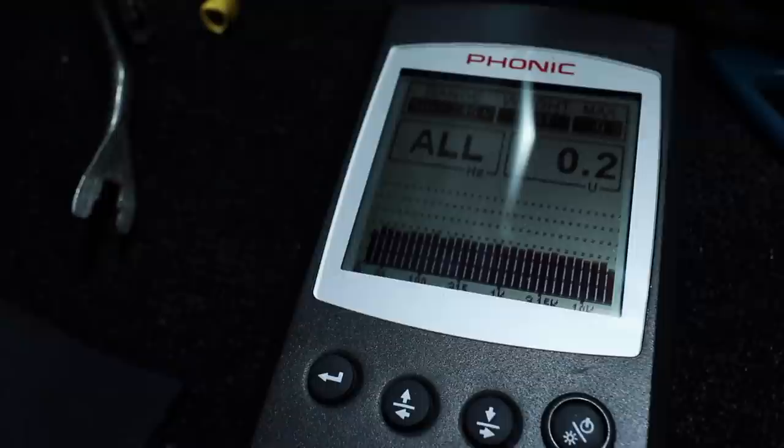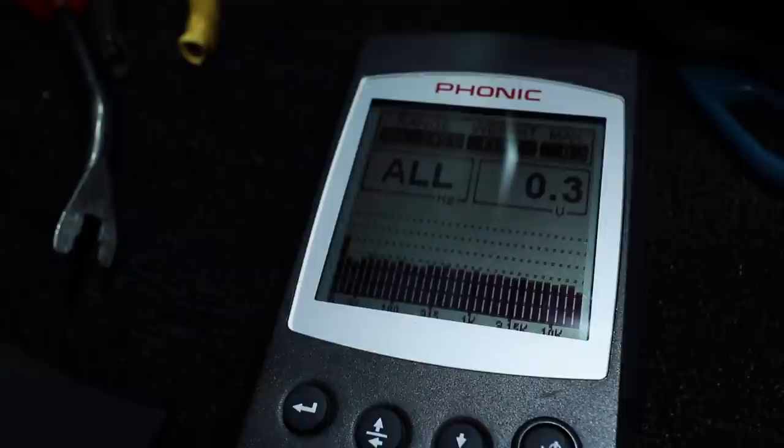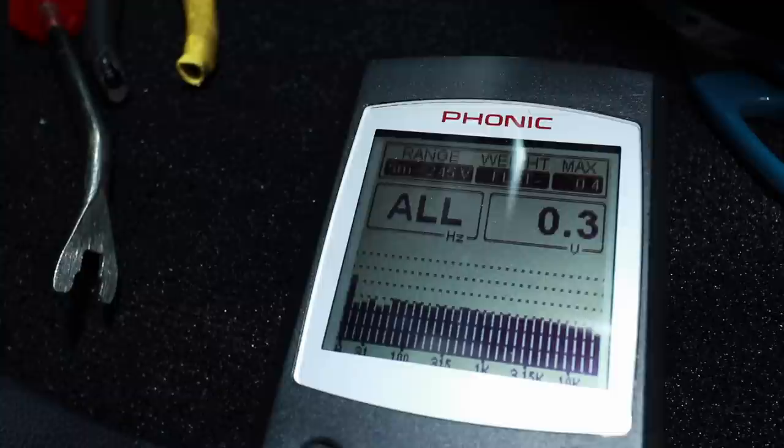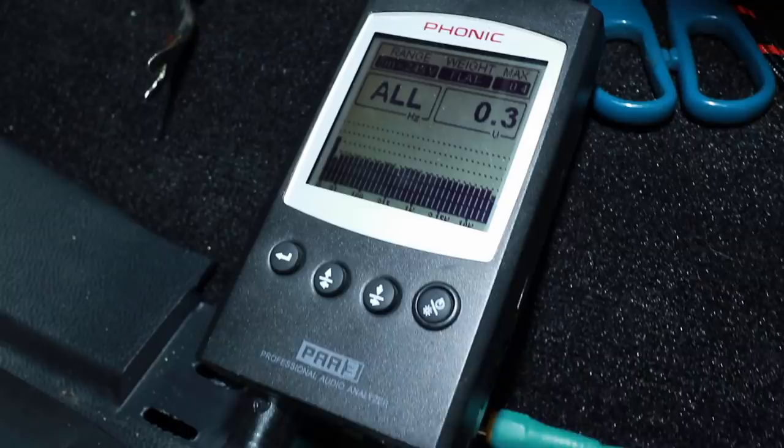Playing pink noise in the system, we see that nice flat output — that is exactly what we want to see. This is what's coming out of the driver's front speaker. We check the volume control by having Fernando turn it up and down. It goes down, it goes back up. We also want to check the blinky light — as you can see, it changes colors, meaning it's properly receiving the signal. Switching over to a rear RCA, the passenger rear door is working. Our signal is working exactly how we want it to — we have front, we have rear, it's ruler flat, perfect for tuning.